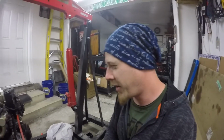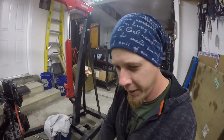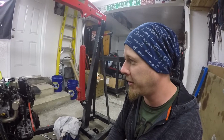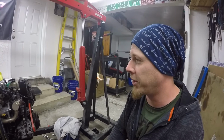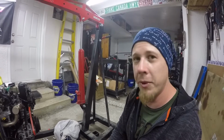But I really don't know what's going to happen here, and I've never run a fuel injection block on the ground before, but I know it's at least going to crank, and then if it doesn't start, I can at least through the week check for ignition and check for fuel injector pulse and that kind of thing to see why it might not be starting.